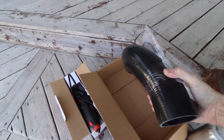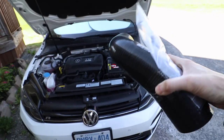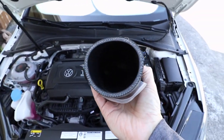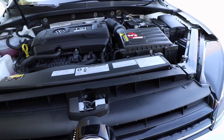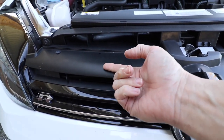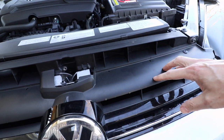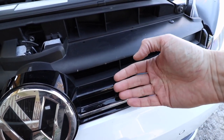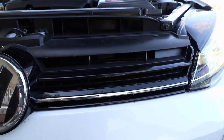Here's the parts: this is the new air intake hose and two new clamps. This part goes on after the filter. There are no instructions with it but I'm going to clean it first — wash it with soap and water inside and out since you're putting it after the filter. Also, if you have a GTI, some of the newer GTIs actually have venting here where air goes in through your grill and is able to escape up and into this. The R's don't have that — it's fully blocked off. Even the 3D printed ram air scoops for GTIs have been tested airflow-wise and temperature-wise and had almost no effect.